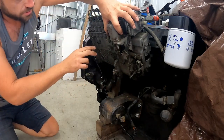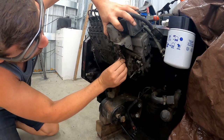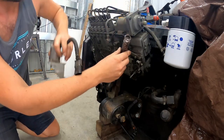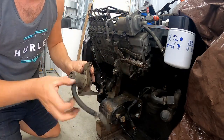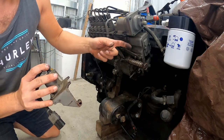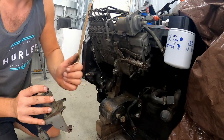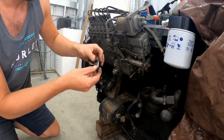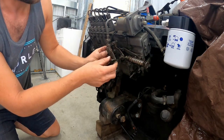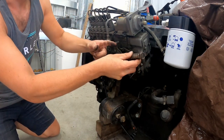Let me show you how it works. Basically, it mounts to the pump up here off of the AFC housing, and it operates the piston up and down, controlling the shutoff, just like that. And what I'm going to be doing is making a bracket similar to this, coming off of the AFC housing. And mine's just going to come down real close to the pump and have kind of a clamp for the push-pull cable. I've already removed the up and down actuator that's on the pump presently on my car, and basically mine will just actuate forward to back like this.